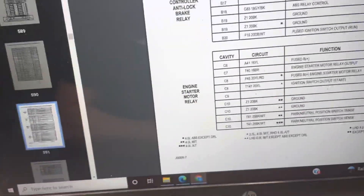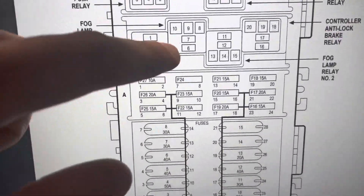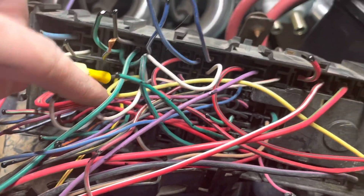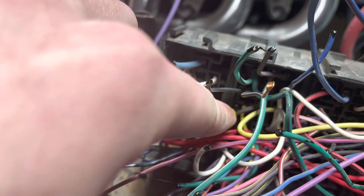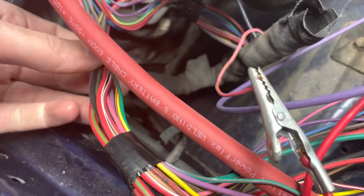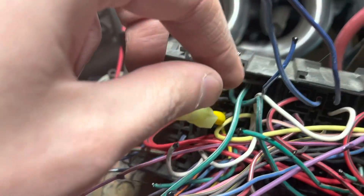Position seven is a brown starter motor relay output, so that will be this middle one — and that is what you're going to be hooking the purple Novak wire to. To run it from the top: big yellow to the battery through a fuse, brown right next to it goes to the purple Novak start wire, smaller yellow with the stripe runs to the ignition, runs down this loom, down here through the passenger firewall, and then the black with the stripe — there are actually two in the same cavity, you only have to ground one — run that to ground.